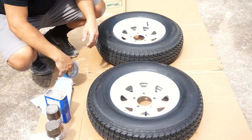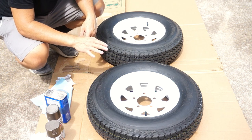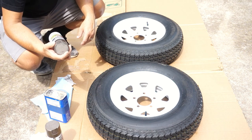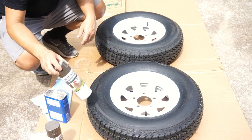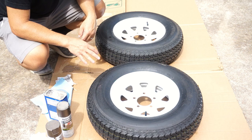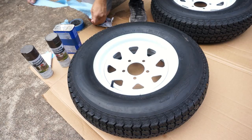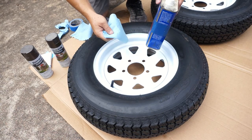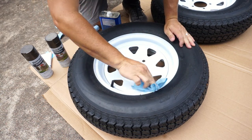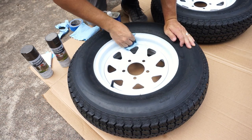These tires just have a standard powder coat white on them — a very thin amount. What we're going to do is change the color a little bit and make it a bronzed, hammered bronze. I found this leftover with the rest of the paint. We're going to clean it off, and then I'll show you a good way to mask it so you get a decent paint job on the rim with the tire still on. First thing is to take some acetone and clean the rim off to remove any oils left over from manufacturing. That way the paint has a better chance of sticking.